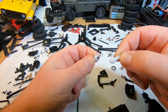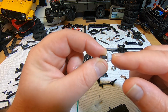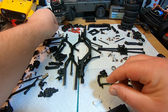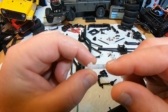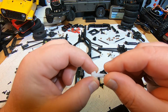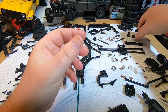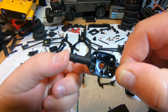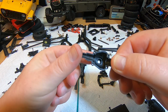Small gear 12 teeth, the way the small gear is mounted to the shaft is different. In the Katana and the CR-18s there is this pin made out of metal, and the EazyRC models do come with this plastic shaft, which is of larger diameter than in the CR-18 and the Katana, and this is directly mounted to the drive shafts. However, this piece of the gear is mounted through this opening, which takes two ball bearings inside and outside, while in the CR-18 and in the Katana there is only one bearing.